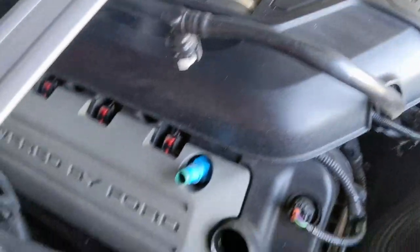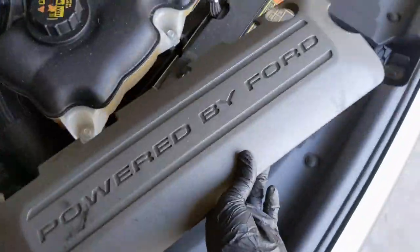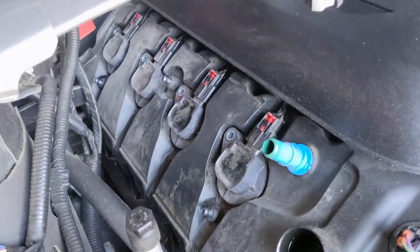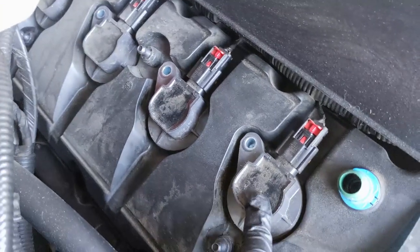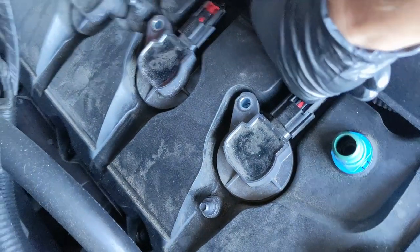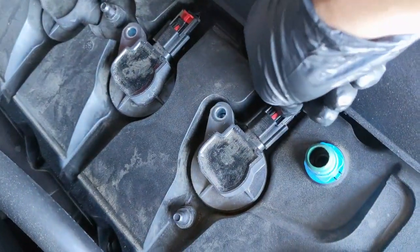Once we do that, it gives us some room. We just pull this little cover off - it's got little push pins that push down on it, so we just pull on it and it comes right off. So here's one bank of spark plugs, and the other one's the other bank. These are our little coils - we got to take these off. We just push these little clips up and then push on the little button there to see if we can get it to come up. It's hard to do with one hand sometimes.